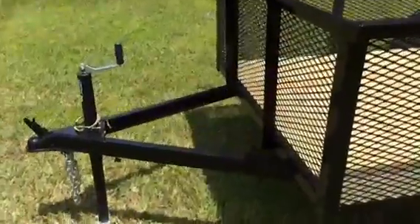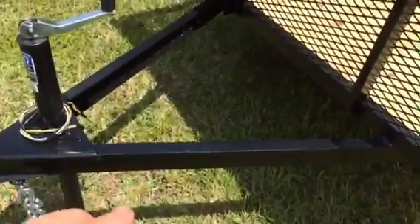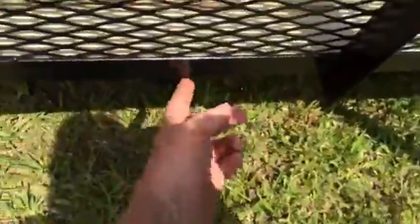When you're purchasing a trailer, you need to look at the tongue or the A-frame. It needs to be made out of channel. For a small single axle trailer like this, three-inch channel will be fine. And it needs to tie in to three spots — it needs to come all the way and tie to the outside frame. If it doesn't do that, it's not structurally sound. That's what gives you the structural integrity of the trailer.